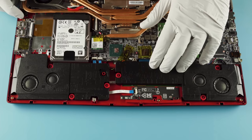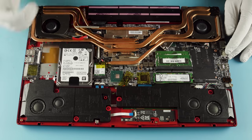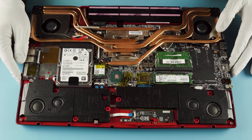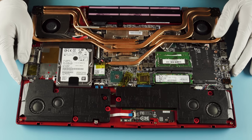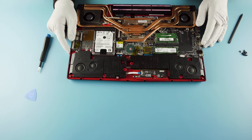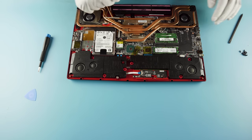Under these, just like in the Leopard, you'll see that the trackpad is there. There's adhesive and it's actually part of the keyboard deck, so replacing that would be a problem — you'd probably end up having to replace the entire keyboard deck to get it done correctly. If you're good at stuff like that, you might be able to use a heat gun from a long distance to soften up that adhesive and take it out.